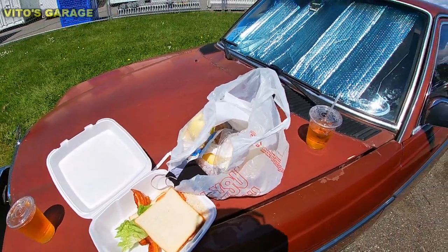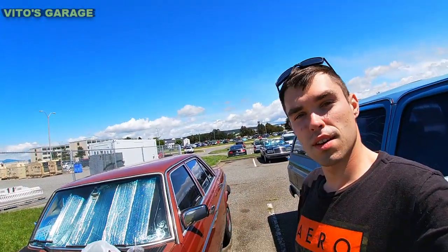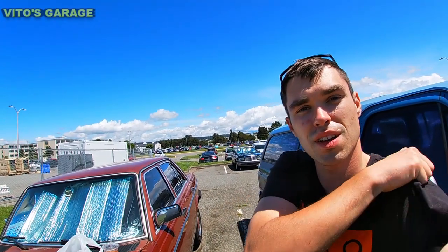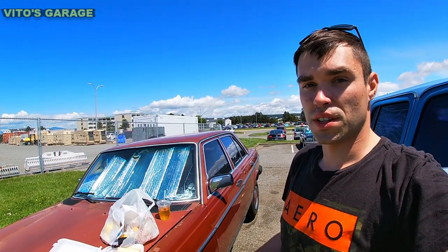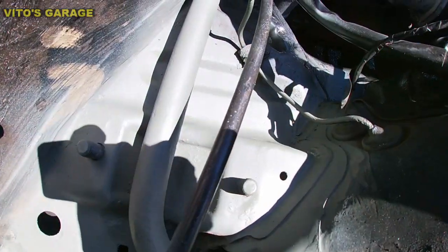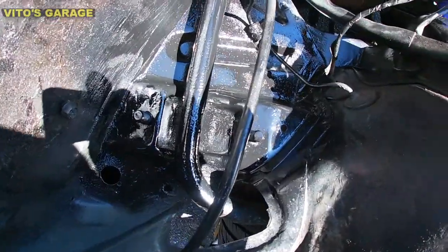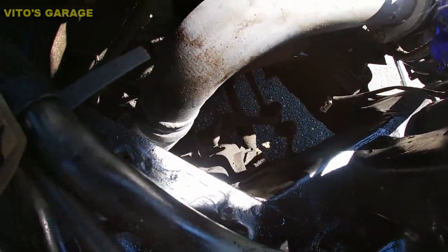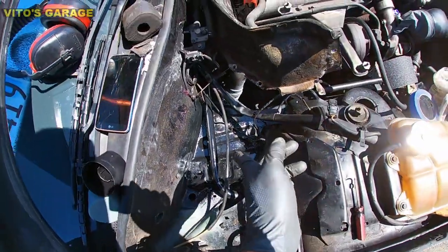About to eat, then I'm going to continue work on cars. It's Sunday, a beautiful sunny Sunday, and we're going to keep going. I'll show you the process and what else I've got left on the W126. As for the W123, it's still jacked up — putting the drive shaft back on today with new flex discs and center support. After cleaning, this is all coated now, and the next step will be to put wheel bearing grease on here and reinstall that mount.